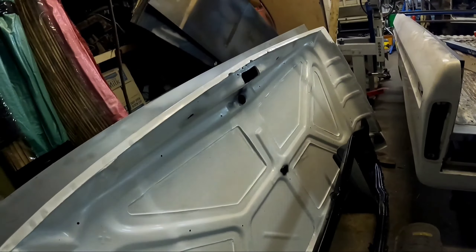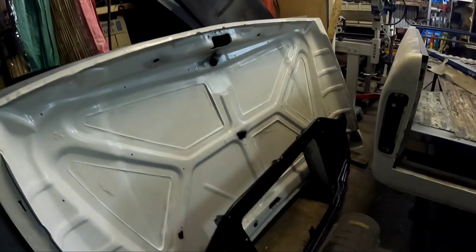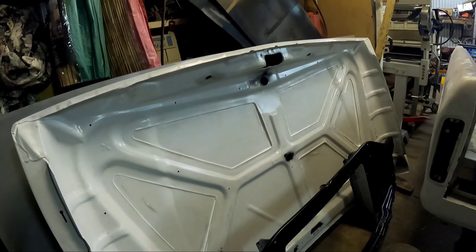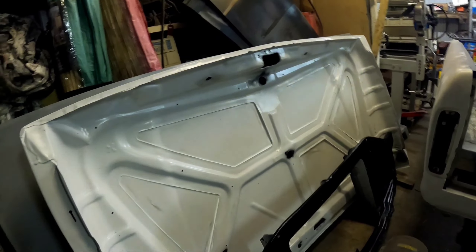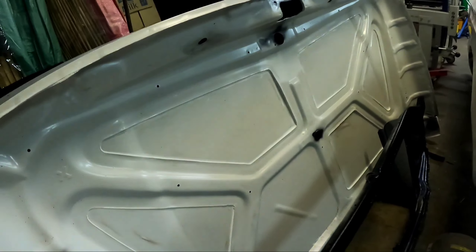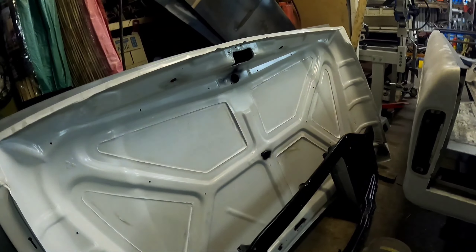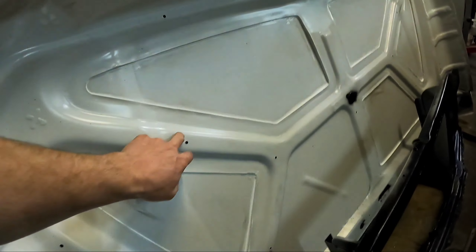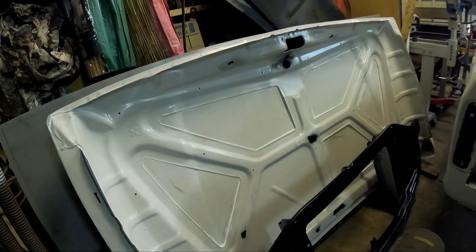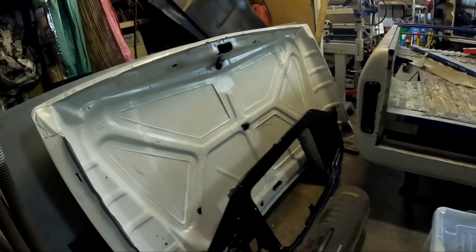The other night I got out here for a little while and seam sealed all the bonnet — so where all the joints and the panels are, where the inner and outer skin mates. The reason I did that was it seals it off from the outside, and also stops stuff from getting in under the inner skin. And also when I get the cavity wax and spray inside between the two panels, it's going to keep it where I want it and not spray all over the outside and over the bonnet.